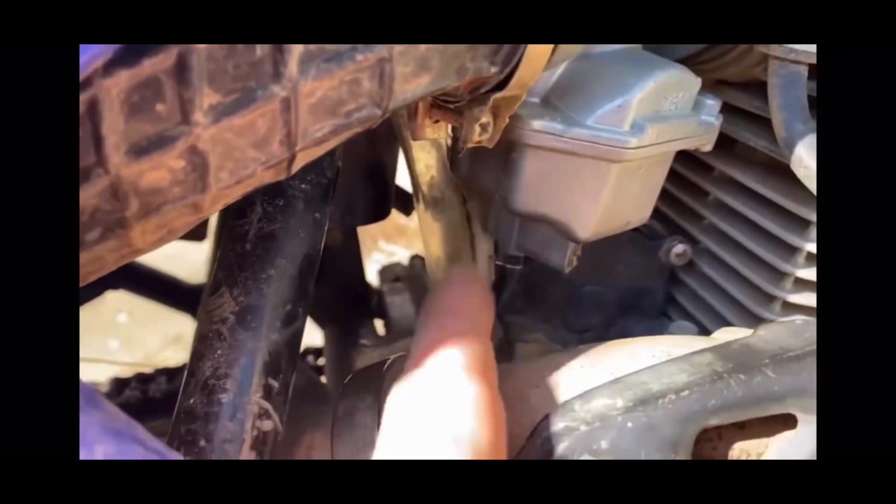So as you guys can see, we have a very clear tube here. No real big dirt particles or anything like that, as you could see earlier in the video with the K&N air filter. Obviously the K&N air filter was leaking. The stock air filter again is not leaking. And as you can see, we've taken a big list of possible things that could have caused the rings to go bad, and we've really narrowed it down to a few things if you think about it.